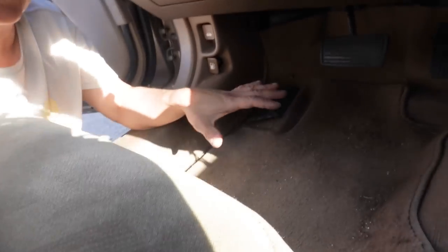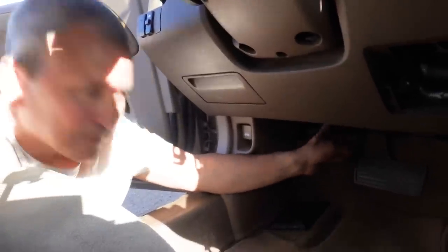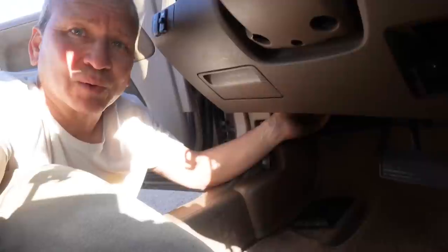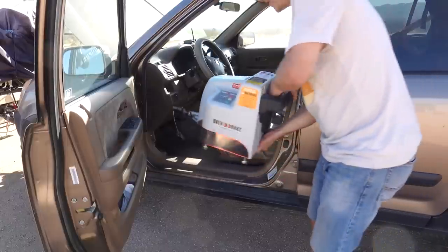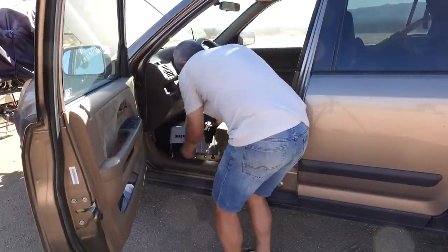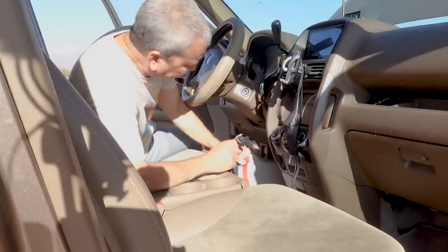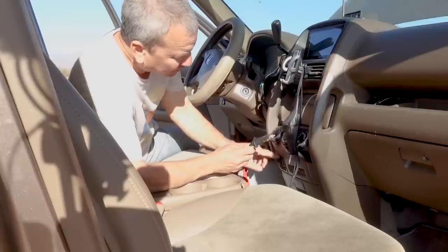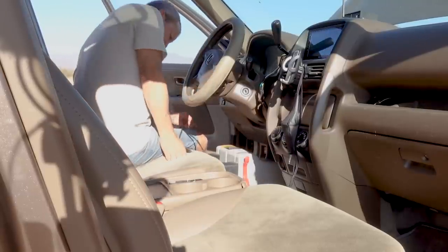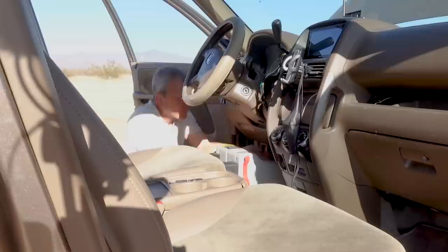The braking system sits here on the floor in front of the driver's seat, and luckily there's already a hole in the firewall, so I was able to run the wires through there and install a receptacle just under the dash, out of sight. That made it easy to just plug the cord in from the braking system. What I'd have to do before was plug it into the receptacle on the dash, which would draw power from the car battery. Now I can just run it over here and plug it into this receptacle under the dash, which is powered from the RV.